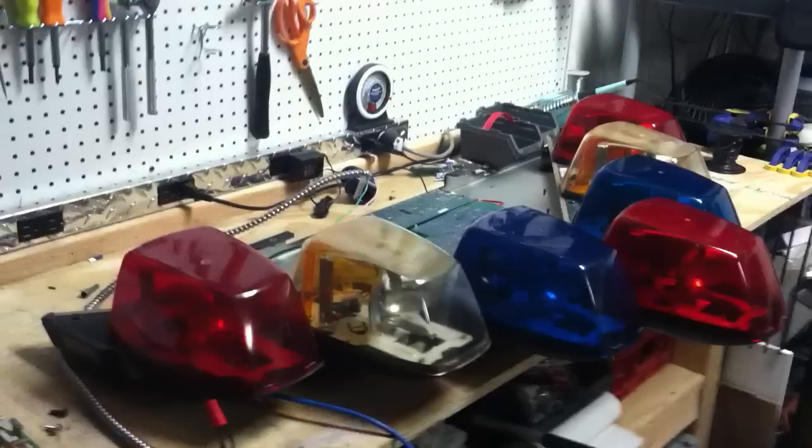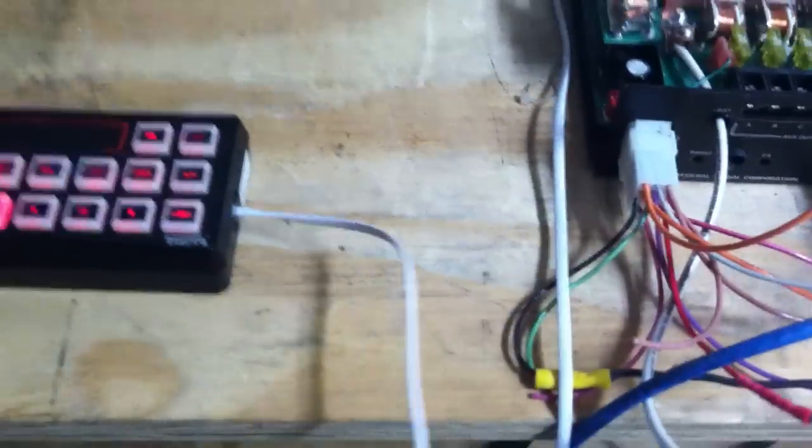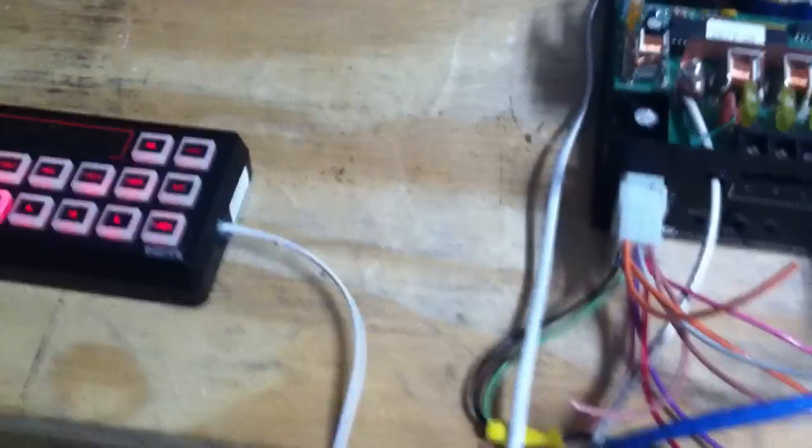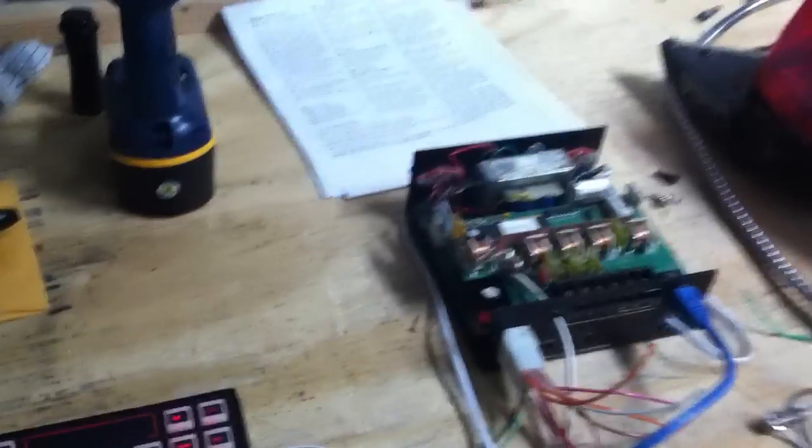I want to put a couple of myths to rest. My controller is a 2.03, the wiring harness is a 1.02 revision, and my light bar is a 1.0-something. Everybody said they needed to be the same version — they do not. They're all three separate and they all work perfectly together. Also, this controller was built for a Vision with a traffic advisor, and mine does not have a traffic advisor, and everything is working fine. For the phone cable question — whether it had to be special, reversed, or whatever — this is literally a 12-foot phone cable from Walmart and it worked just fine. It does have to have four conductors; my original test cable only had two conductors. Once I got a four-conductor cable, it works beautifully.